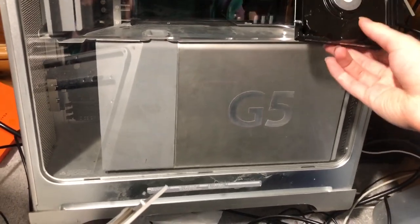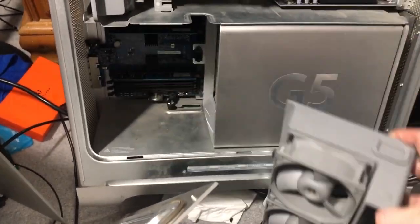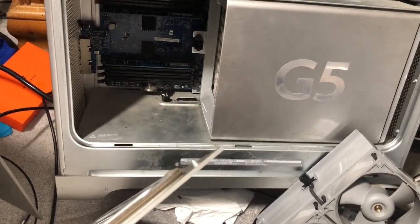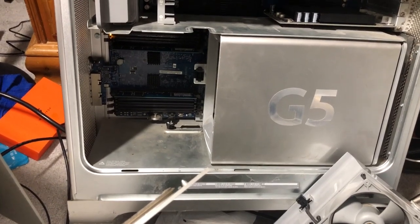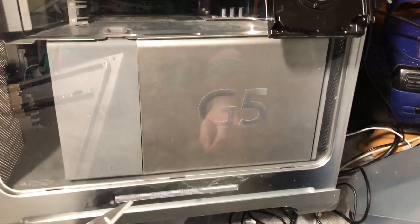The SMU reset uses a button on the motherboard. I saw the button earlier — take out the fan and you can see that little button down there. Press it, and I think that should be it. Let me quickly confirm. I should now turn it on — hopefully the hard drive hasn't been damaged, it's landed on carpet. Chime — that's something.